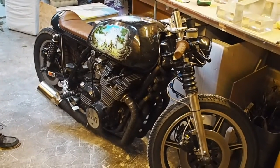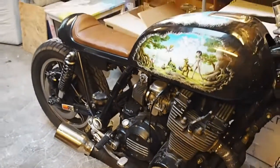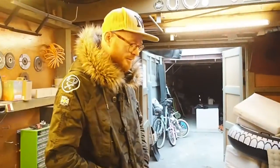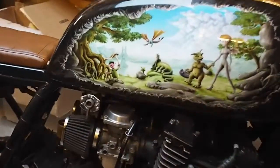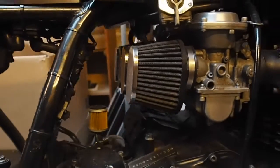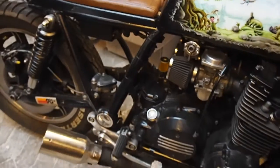So what are we looking at? This is a Yamaha XS1100 from 1981. I got it half done, so the main parts were already fixed — the engine. The air filters were already kind of as they are. I pulled off the big air can and put on some oval-shaped filters, which worked fine. The last bike I had, I put on round ones and they never really worked well, but the oval ones are doing a really good job.